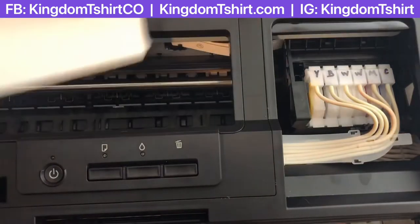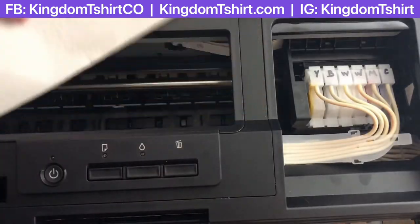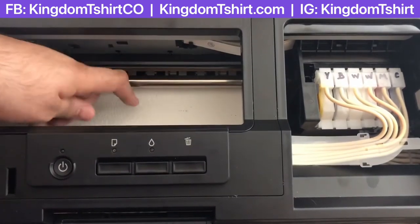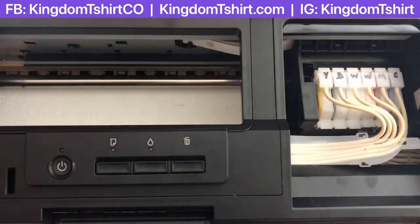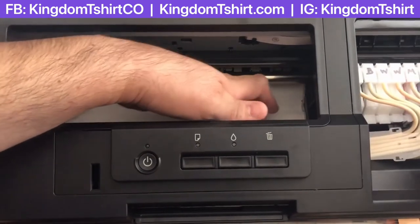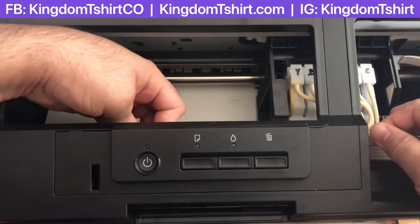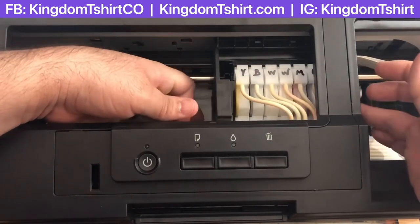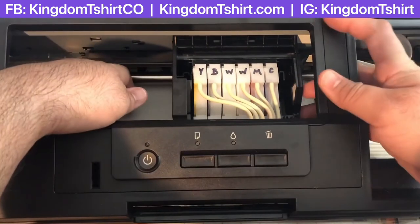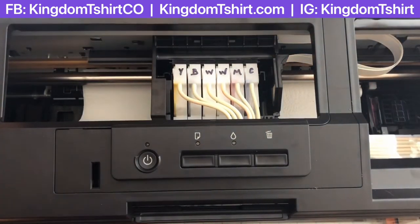What you're going to do is grab a napkin, fold it at least three ways, and put it all the way inside, under this bar over here. Then press a little bit and start moving your print head just a little bit — slowly — and your ink line has to be here. Your print head should be completely under the napkin, and then you can pull the napkin through.